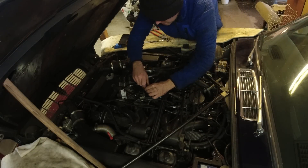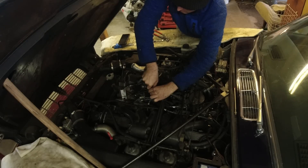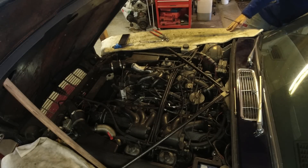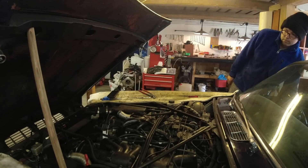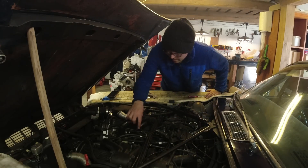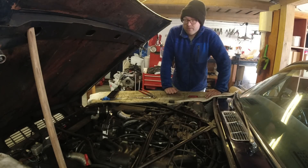Alright, it's running. I think it's the same as before - let me do the advancement of it. It's a bit better, but I can only get it to 5 degrees now with it advanced as much as that will go. Same thing again - take it off and move it just a little bit more. But it's a lot, lot happier now. We need about 5 more degrees.